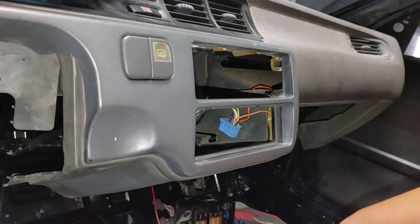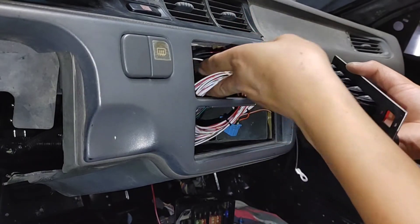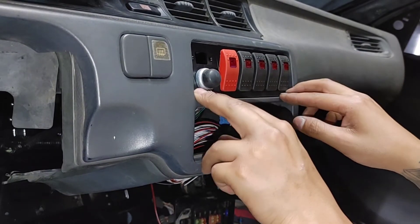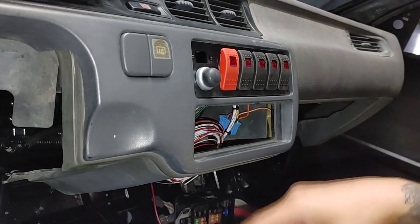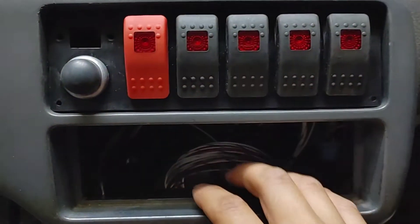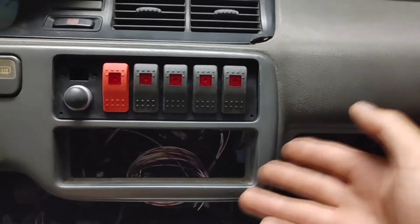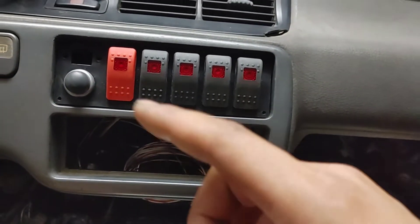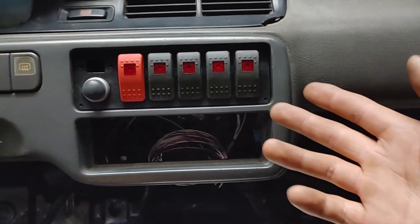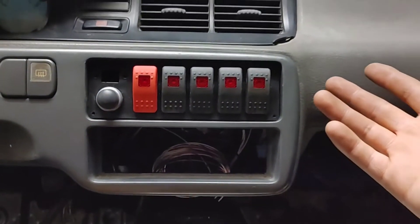Alright guys, before we conclude this video — next video I'll probably show how I wire in my ignition to the main power. Shove these wires through, make sure this fits — and it does. So it'll sit just like this and it looks really nice. This is pretty much what it's going to look like once it's wired up. In this radio slot we're going to have a block-off plate for a single gauge and that's where we're going to run our wideband so we can tune the car and monitor the air-fuel ratio. I was also thinking a block-off plate for two gauges to monitor oil pressure — they're only like 15 bucks, or I could just drill a hole.